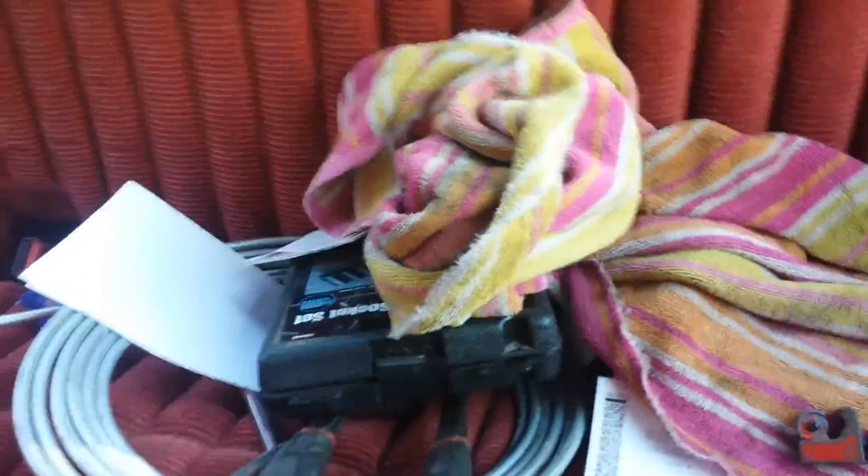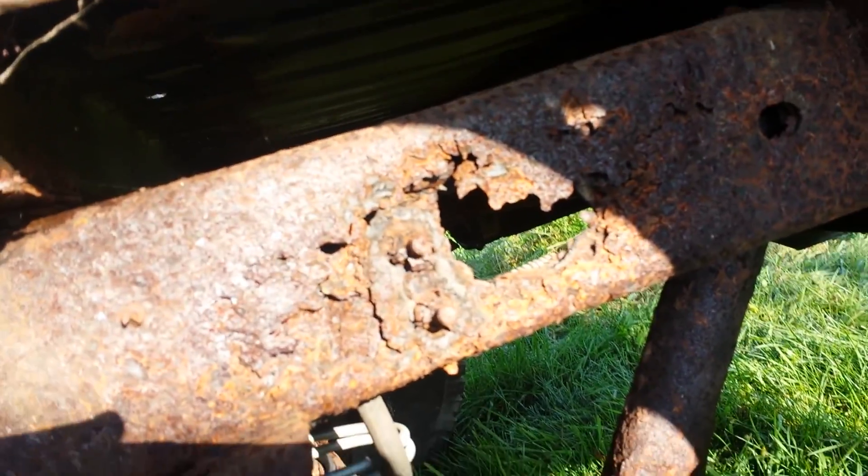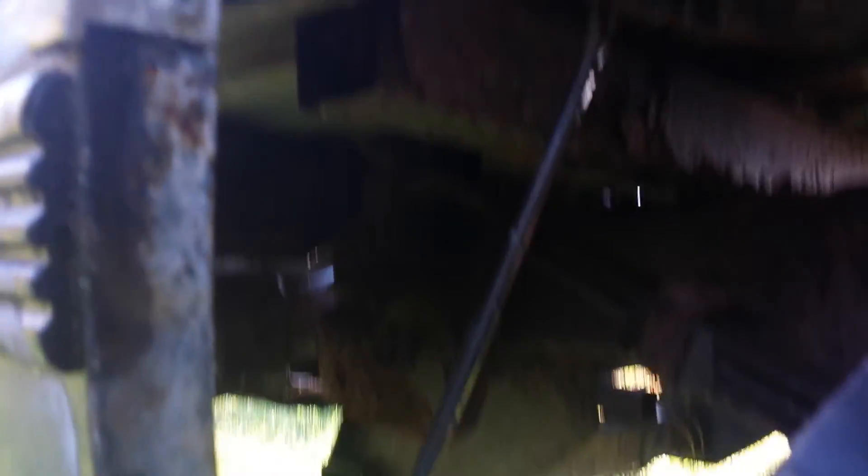I had to put a gas line on it and stuff like that. There is all my tools. Right there — hole in the frame, no good. Frame is rusted out. I'm going to get a better view on the back. No tailgate. Floor's alright. The leaf spring is not supposed to be touching the bed of the truck — it's supposed to be down in that hanger there. The hangers are junk.